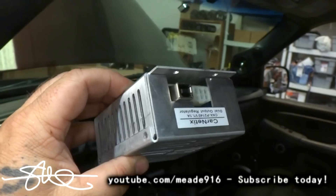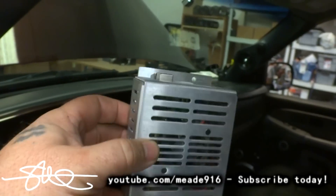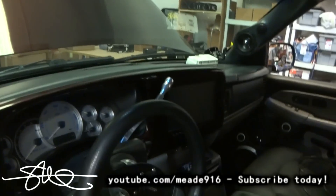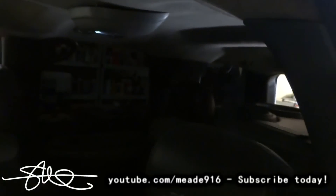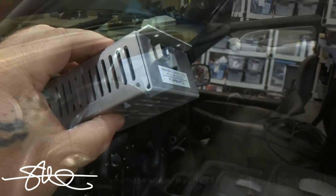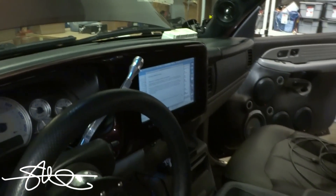It supplies a constant 12 volts — it won't vary at all; it won't be at 15, 14, or 13 when the bass is hitting. It just stays at 12. This is a regulator. This thing went out, and when it went out, my computer went out and basically the whole front end went out. Everything in the back is still brand new — no problem. Switch this out and now I'm back in business. Now that it's all running, time to make a few changes.